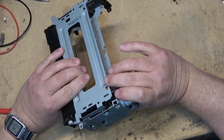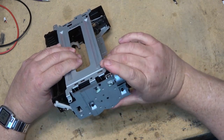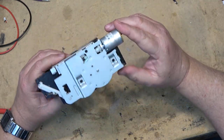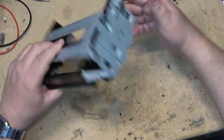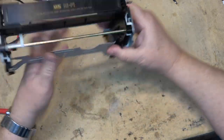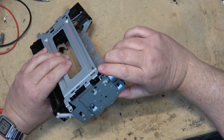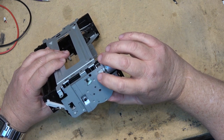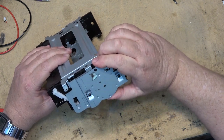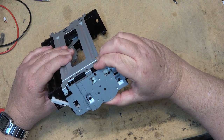When these machines operate — loading the mechanism manually here — you'll see there are a couple of gears on the side, a motor, and a rod that goes through, then some more gears on the other side. How these operate is when the mechanism retracts or the tape unloads, this motor comes on, which spins this worm gear, and the worm gear turns this drive gear which operates the mechanism.